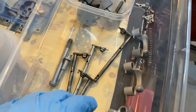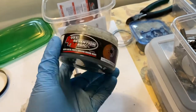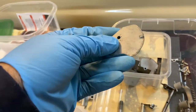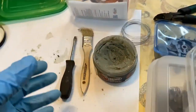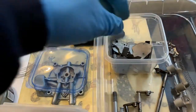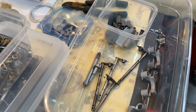Most of the small parts you can blast and clean up. Once you do that, I suggest using a product called Rust Prevention Magic. It's not cheap — I believe I paid about 30 bucks for this little can — but it does a great job coating any bare metal parts that are clean. I blast them, heat the part up with a heat gun, string it up with bailing wire, and the Rust Prevention Magic really melts into any surface that's been warmed up. Then you just brush off the excess, let it dry, and it does a great job protecting bare metal from the elements — better than paint.